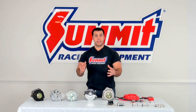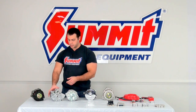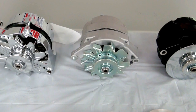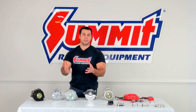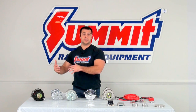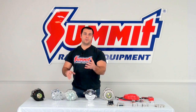The first thing I want to talk about is sizing or finding the right alternator for your vehicle. Here I have some early designed alternators — this is a 1G alternator for Ford, and this is a 10SI alternator for GM vehicles. These were common in a lot of early muscle cars, and some people feel the need to upgrade to get higher output because now you're running electric fans, a sound system, and some of these early OE alternators just don't have enough output to keep up with the electrical demands.